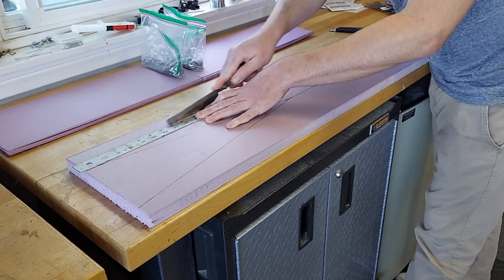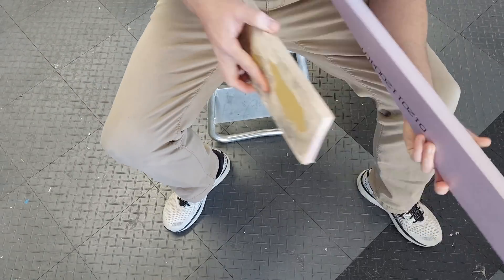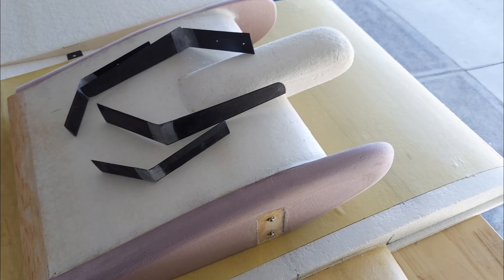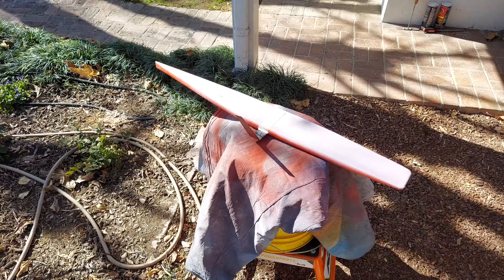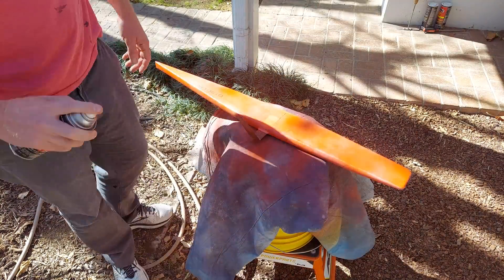The differential motor thrust and lack of a water rudder did not appear to be sufficient for steering, and the hydrofoil had been too tall and was easy for the wind to flip over. The hand-carved foils had worked quite well, and I decided to transplant them to a larger boat that addressed all the lessons learned.